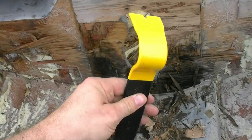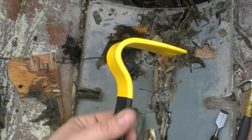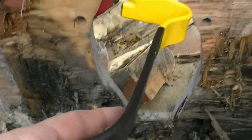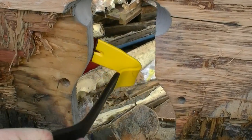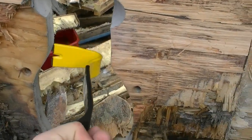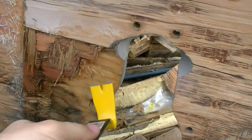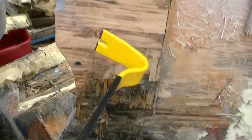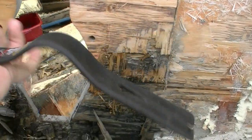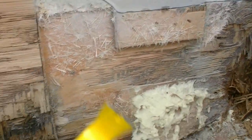This pry bar gives you lots of different prying options and you can hit your hammer right on it. You should only use this one for removing the top layer. You never want to go in and pry against the hull, ever, because what's going to happen is you're going to split the gel coat and the hull on the outside. I'm using this to get the big portions off the first layer — I also use it to pull baseboards off at work, so it works pretty nice.